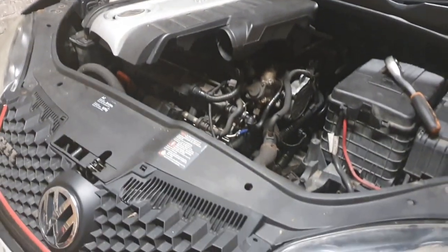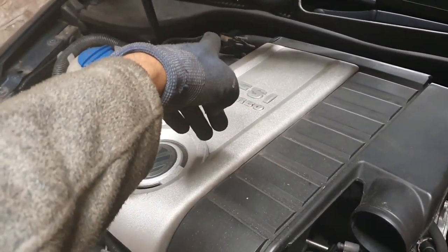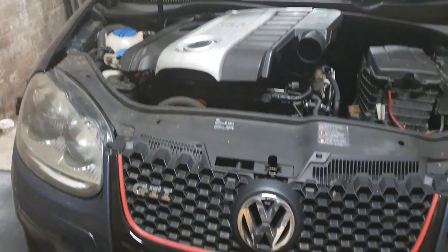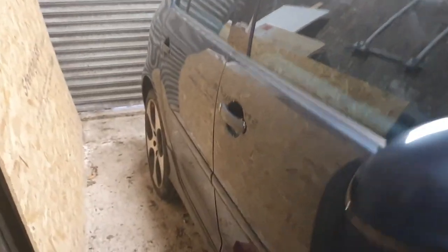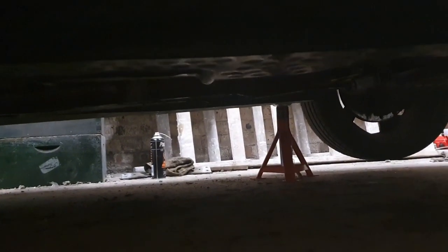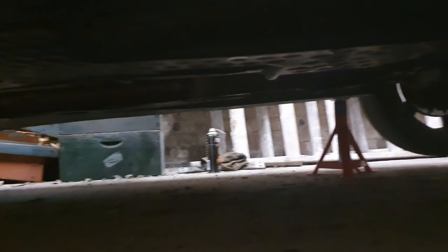That's everything back together and the sports cat is on. I've just put the engine cover back on so any air going into the engine is filtered and the MAF is connected. I've left it open so I can check for any leaks at the manifold — that was a nightmare of a job but got it done. There's the old cat and downpipe, and that top part broke off. I'll show you underneath — I'll just put the camera underneath. The sports cat's on and I put a bit of exhaust paste on as well. I didn't have a clamp that fitted the top join but the pipe isn't too far off, so fingers crossed it's okay. Here we go, first start.